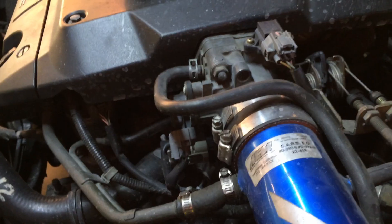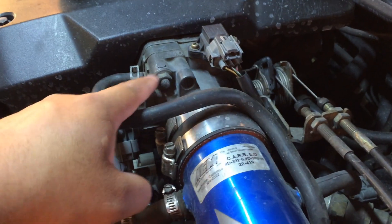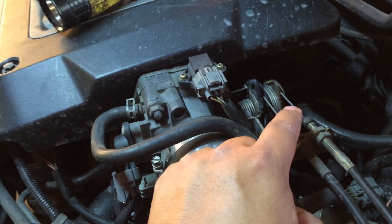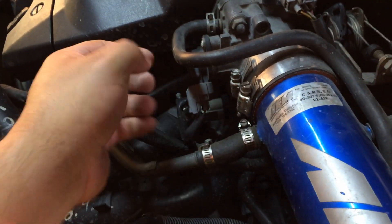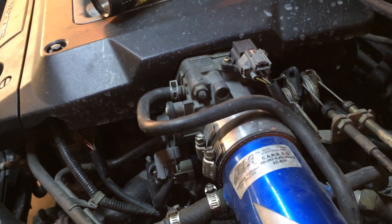Actually, there's two bolts and two nuts — two nuts are on top. I'm going to pop this loose and separate that from the throttle body. I'm going to take these four bolts out, disconnect this hose, and all the connectors. I'm going to leave the throttle cable attached. There's one connector here, there's one on the idle air control valve where the connectors are. Once I have that free and clear, I can just flip this thing over and gain access to the bottom of the throttle body that way. The less stuff you have to remove, the better.